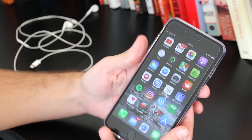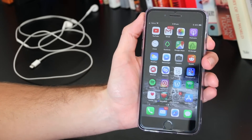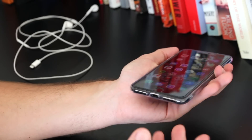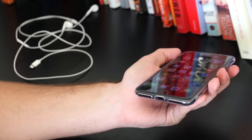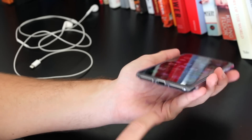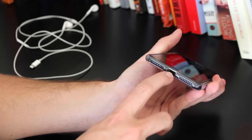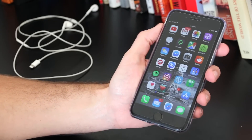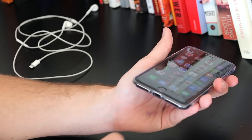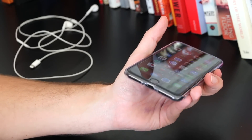Having your iPhone in your pocket or bag constantly, it does get a lot of dirt, grime, sand — all that stuff that can accumulate over time. If it accumulates it can make these connections dirty and then trick the iPhone into thinking that it has headphones. This is also an issue you might be having if your iPhone isn't charging.